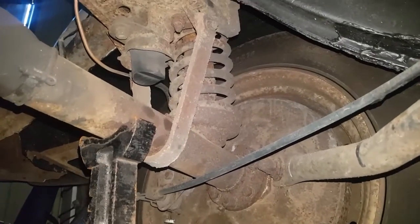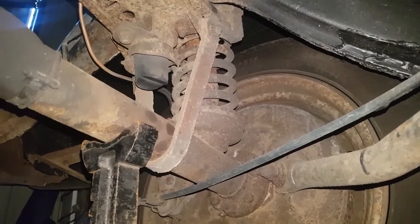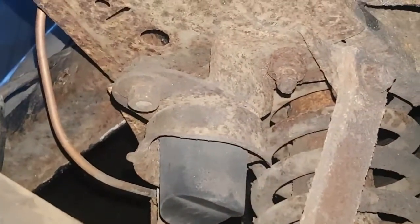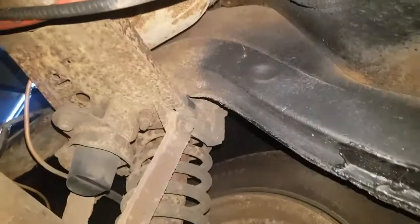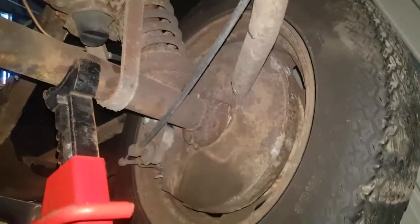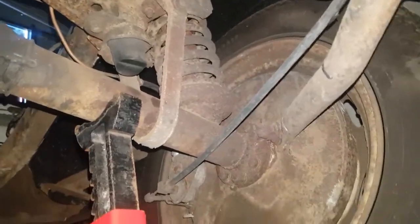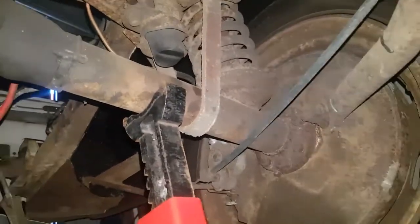If this side of the car is going up while the other side's going down, hitting the bump stop, there's nothing there to stop it, so the strap is there to stop it rolling any further. There is a nut there either side of the bump stop that attaches the entire rear axle to the crossmember and to the chassis legs of the car. Then from the end of the torque tubes going up to the centre of the car, roughly where the handbrake is, those basically stabilise the sideways movement. At that end you have two clamps with a couple of bushes there as well that attach you to the middle of the car. I'm told not to touch any of that because this assembly apparently outlasts the owner's life.